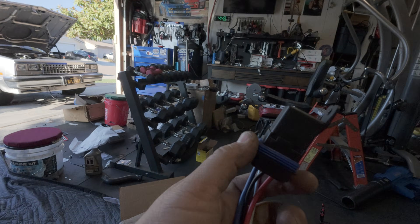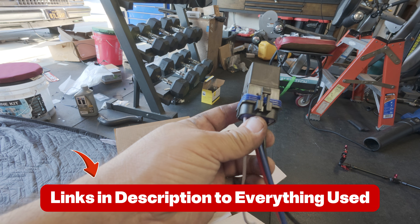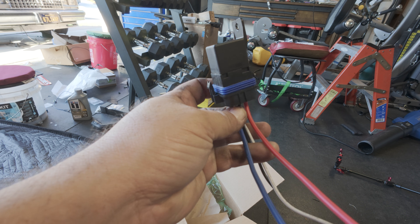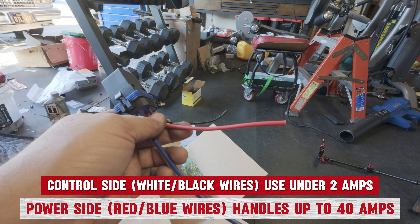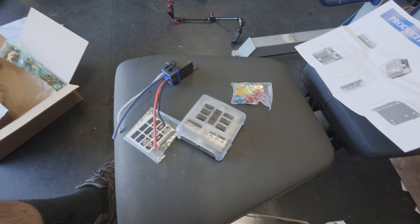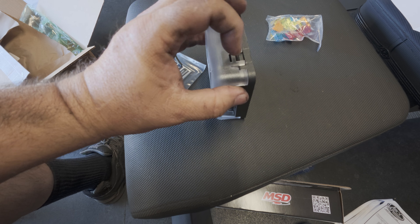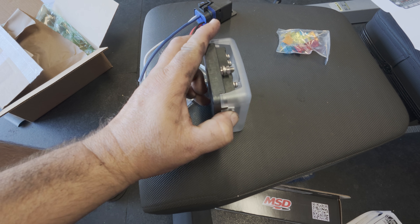The way we're going to do that is real simple — relays. Relays are used to control big power with little power. This red wire and this blue wire here can handle 30 to 40 amps. To support that, we hook up 10 gauge wire to the battery with a 40 amp fuse on the red one, and the blue one is going to power up our own little fuse circuit — a fuse box we got off Amazon. Links are always in the description.